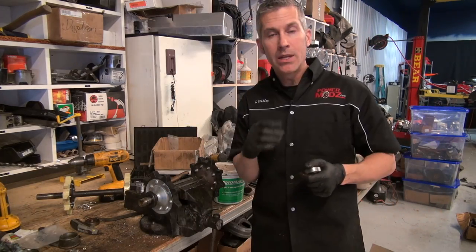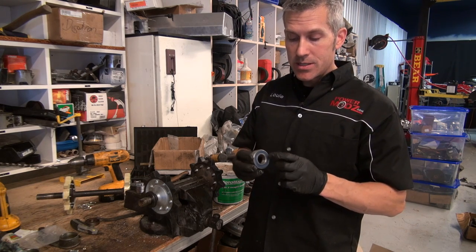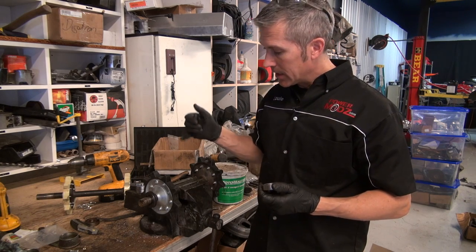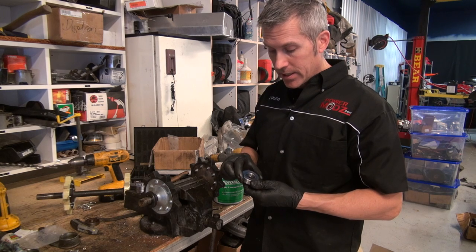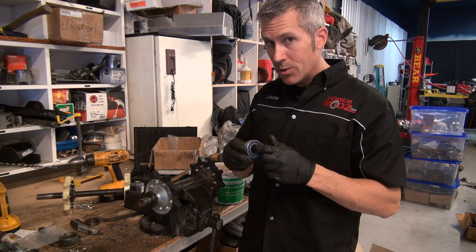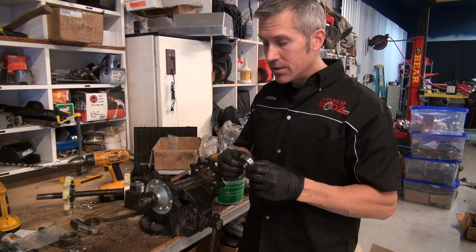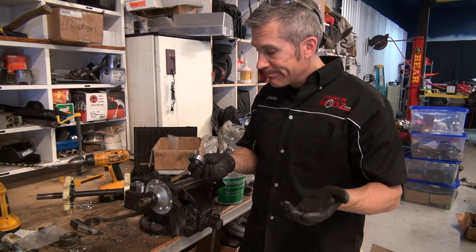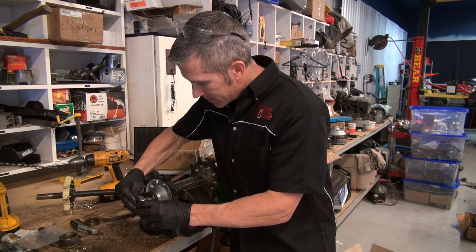That's that. Now there are a couple of different ways you can do this. What they usually do is they pop off one of these seals, put it on the shaft, and then you grease it through the back axle shaft. There's a little grease nipple that goes on there. I do things a little differently. I leave these bearings because they're a better quality bearing. They have a great low temp grease in there. I leave them both sealed and I replace them every couple of years. That's just the way I do it. You know, it's totally up to you the way you do it. But I like to do it like this.